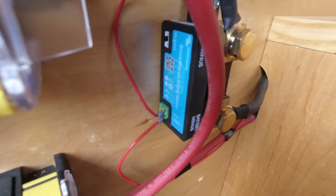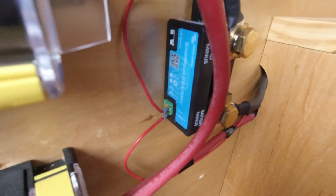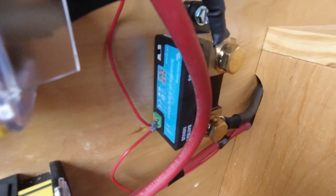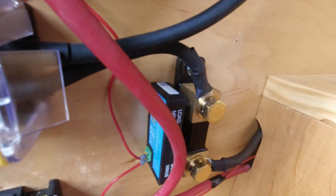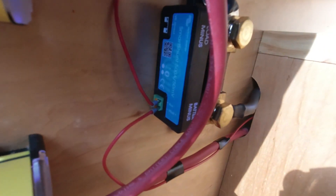It's a pretty small addition and pretty inexpensive for what it does, and you get that legendary Victron quality. Their bread and butter is really the boating industry, which has much more robust requirements than RV use. It pairs up nicely with the Victron Battery Protect over here, which basically allows me to set a shutdown battery voltage so the battery isn't drawn past where it might be damaged. I hope that gives you a little overview of the Victron Smart Shunt. It's a pretty new device on the market and I hope this helps you decide whether you want one and understand what it can do for you.